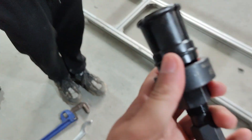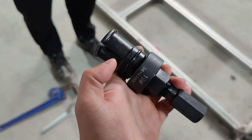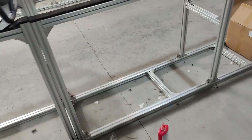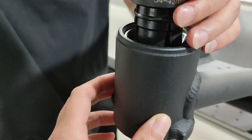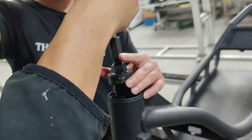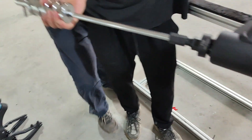I'm going to show you how to take out the bearing race. You need a tool like this — 34 to 43 millimeters — and a puller like this. Take the puller and expand it so you can keep some pressure into it.